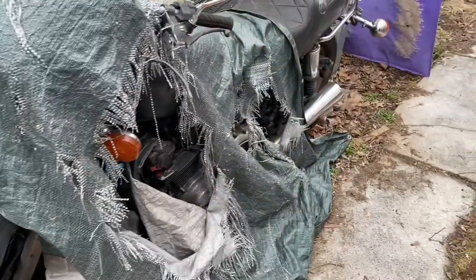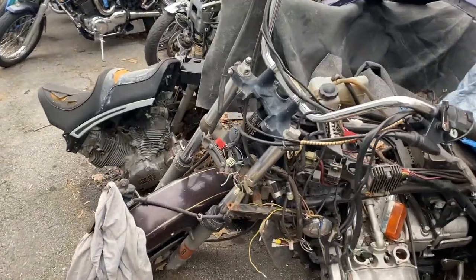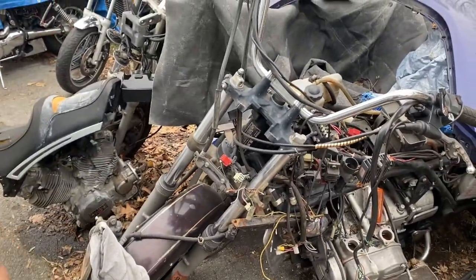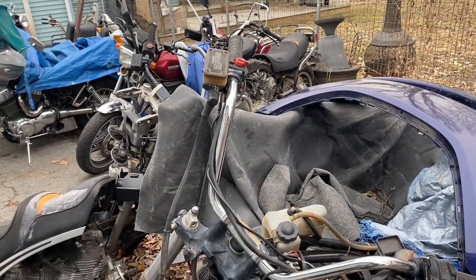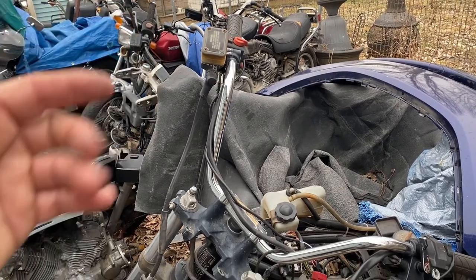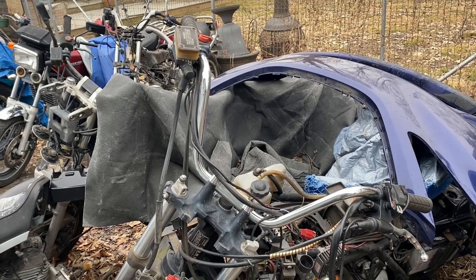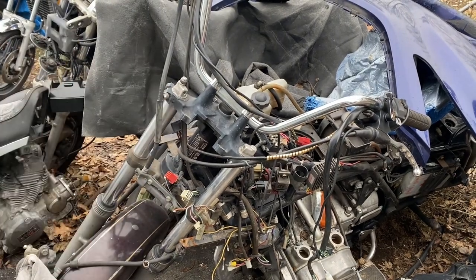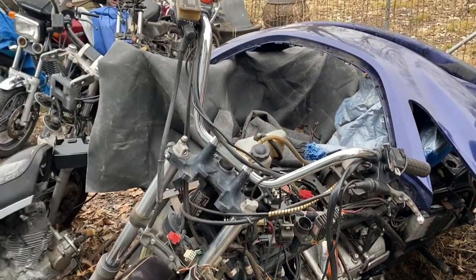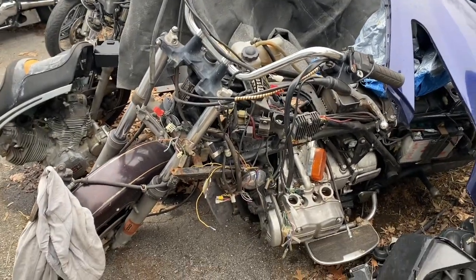We could change fluid this way also — pump all the old fluid out and as you pump it out, keep filling the reservoir with new fluid, pushing out all the old junk until new fluid comes out the bottom. That's a great way to do it if it's a wet system. If it's dry, you want to push new fluid up so you're keeping all the air bubbles moving upwards and out the top.